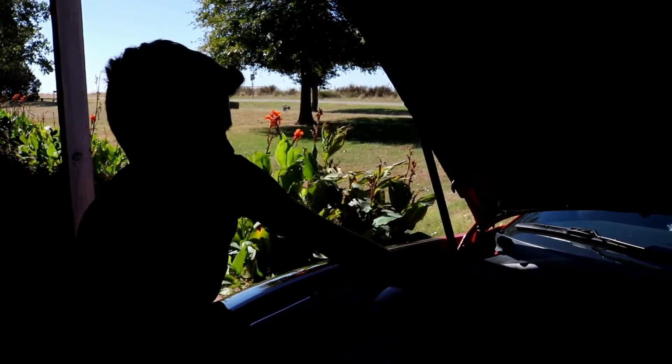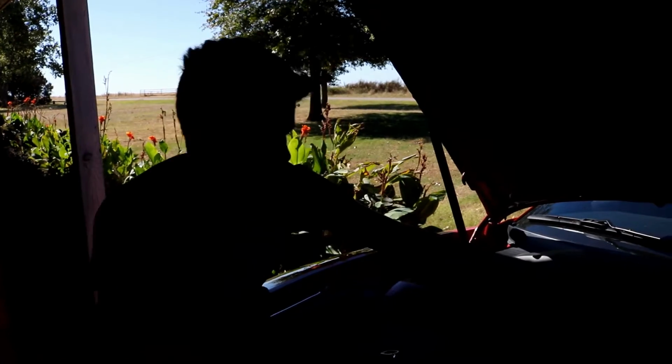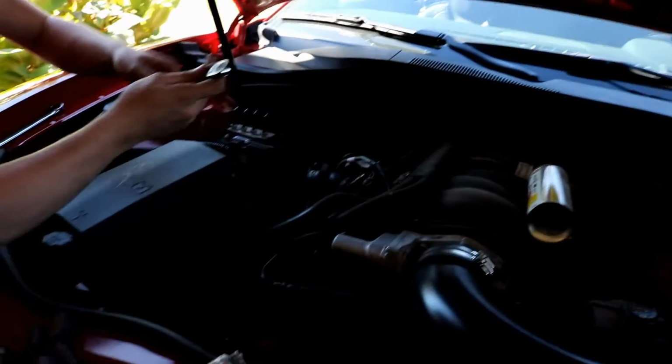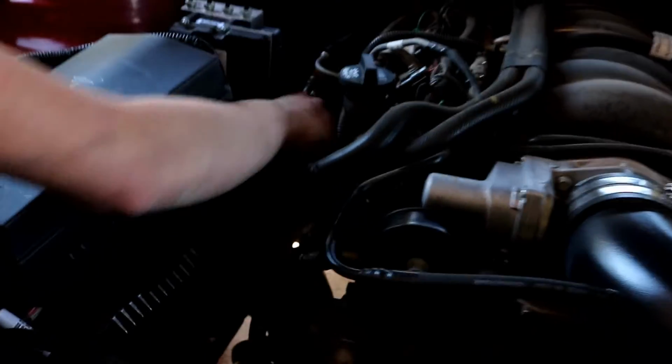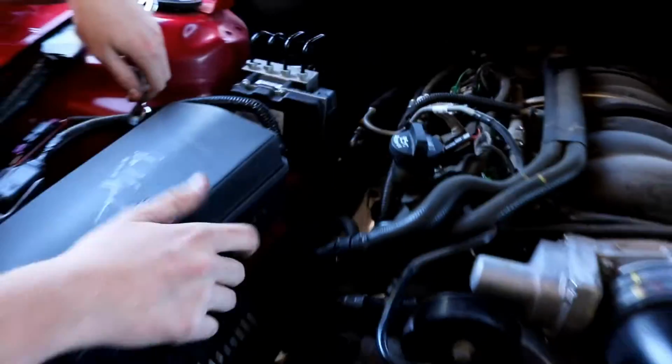First things we had to do was, of course, unhook the O2 sensors from the bottom of the car, or from over here, so we're going to be hooking up O2 extensions. After we did those, we unscrewed the flanges to the caps right here and took those out, which gives us access to get underneath these and pull them out, and pulled out the spark plug wires, basically just pulled both sides out. Yeah, and that was kind of a bitch. Took out the dipstick, it was just one screw, and pulled off this and the strut bar. And that's basically what we've done so far.